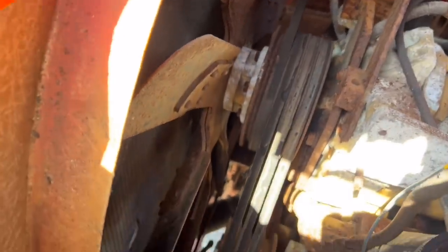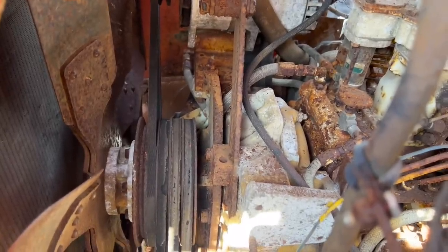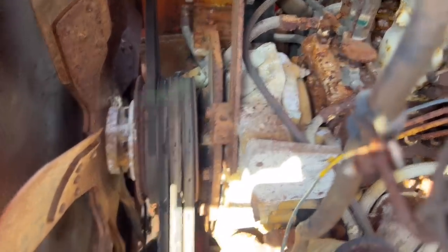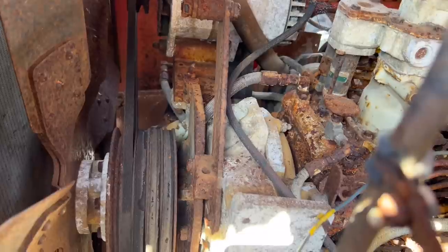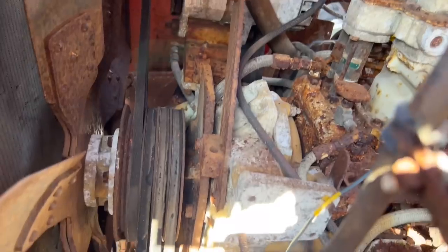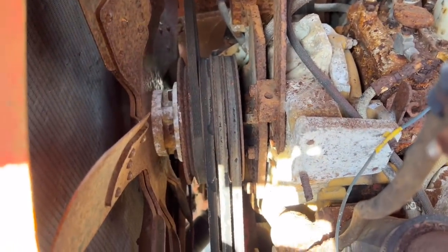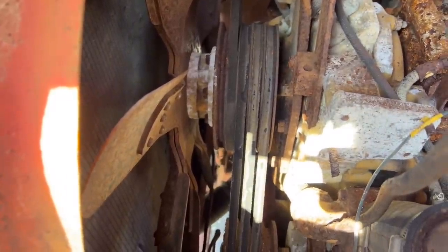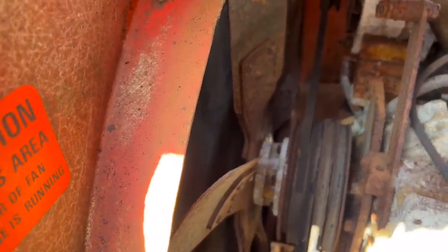What else we got going on? That's about it really. There's a leak coming from somewhere — I've already found one of the leaks. There's a coolant leak on the pipe that runs under the exhaust manifold on the passenger side — some sort of link pipe, I assume just something to do with coolant circulation to avoid hot spots. I'm guessing the other one is either the bottom radiator hose or the bottom radiator gasket. My auto car's got the same sort of setup, three-piece radiator, and it leaked from the exact same spot.